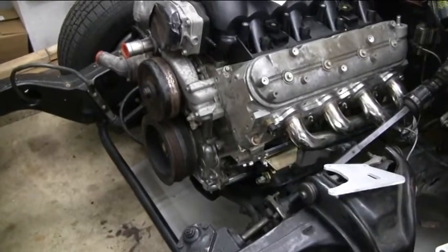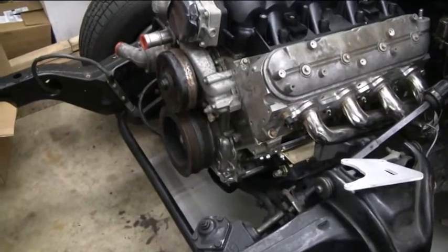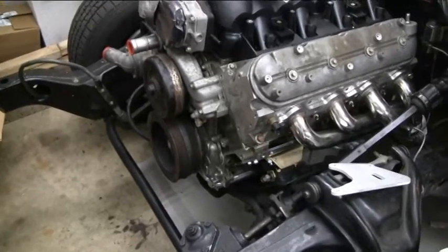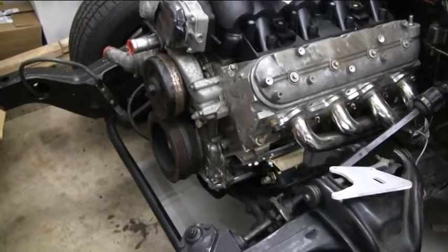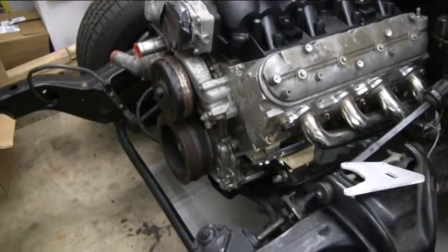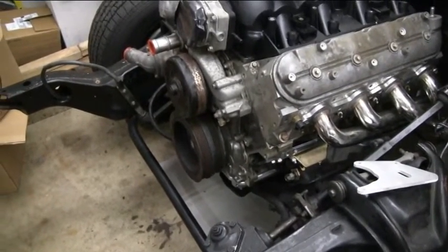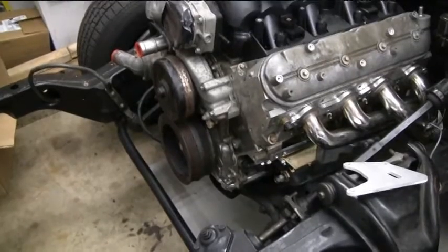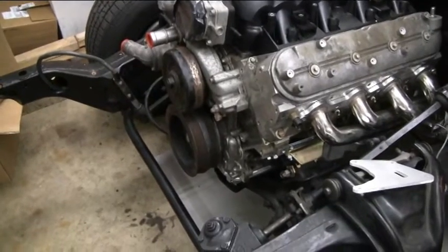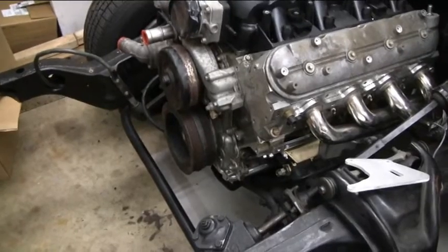This is a G8 motor, modeled after the Cadillac and Corvette, so it's the tightest one against the block. Ellis Brackets makes sets for all the different spacings — you just tell them what you have and they'll send it to you. It does change what you can do with the power steering pump. I could not use a pump-reservoir combination; I have to use a remote reservoir, which adds some expense. I could change to a less expensive bracket system if I got a new water pump and crank pulley, but I just stuck with the Corvette style.